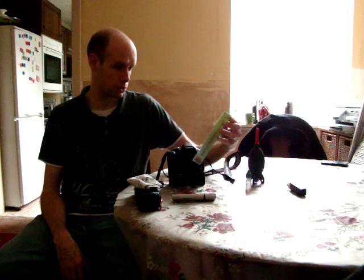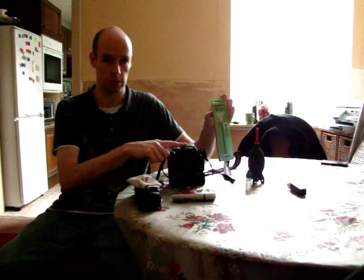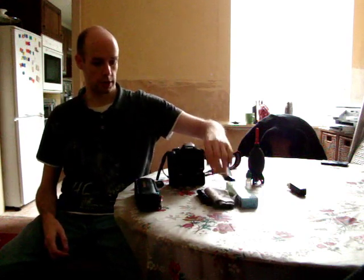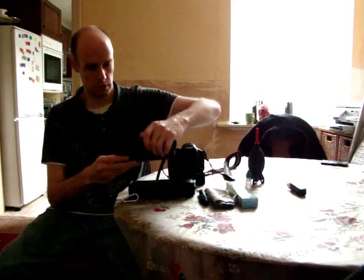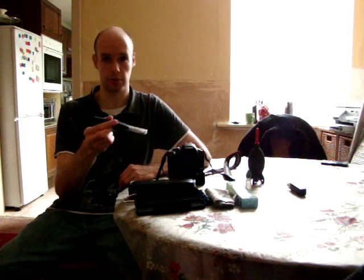These are the green swabs — there are 12 in a pack and they are for the 1.6x crop sensor, which is the correct size for the sensor on the 500D. I've also got a couple of lens pens with brushes to clean around the body of the camera and lenses, plus a lens cloth. I've also got this thing in a pouch here, which is another Visible Dust product called the Arctic Butterfly — a battery-powered device which you charge up with a static charge and then brush across the sensor filter to lift dust off.